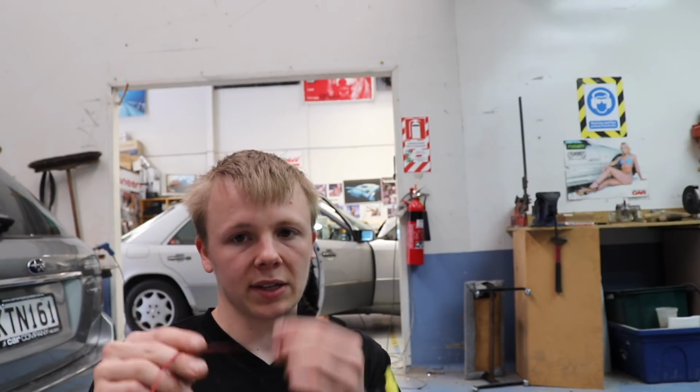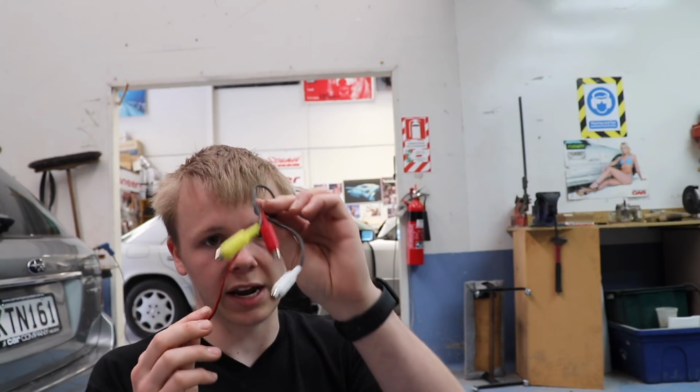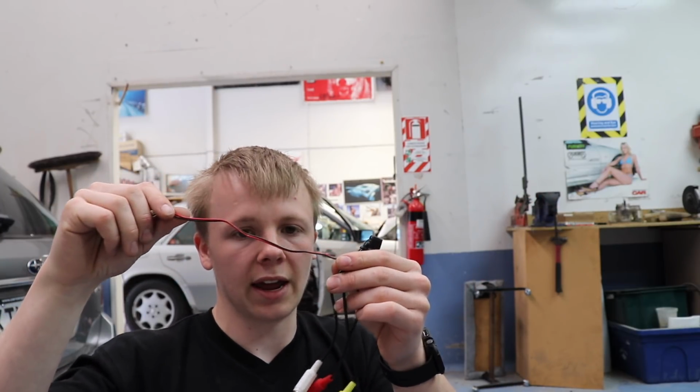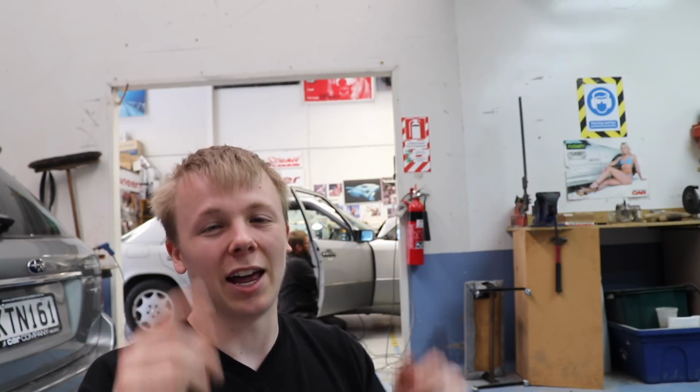And all that means is I'm going to have to do one little Y split of my rear camera's video signal. It'll split into that unit and into the stereo. And then the way this relay is going to be triggered is by the trigger output of that module there. So naturally, when the circuit is open, the video signal from my camera is just going to flow through this and into my stereo so I can view it at any time. But as soon as a sensor or reverse trigger or anything goes off, the output of that is going to trigger this relay, which will switch the video signal over to the output of that module, which will also be receiving the video signal from my rear camera, and it will display it like that.